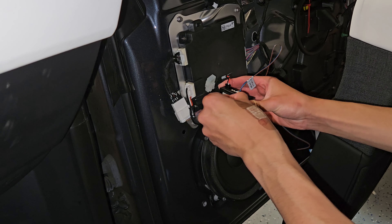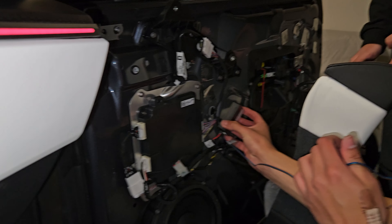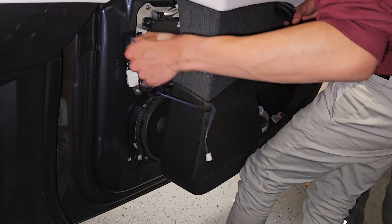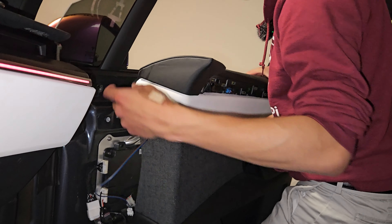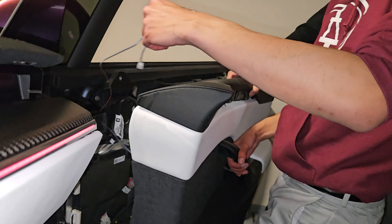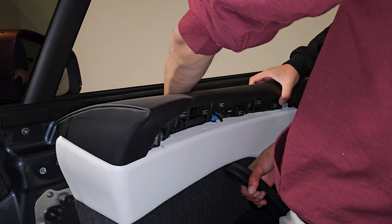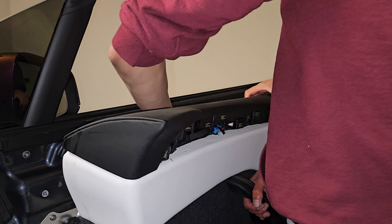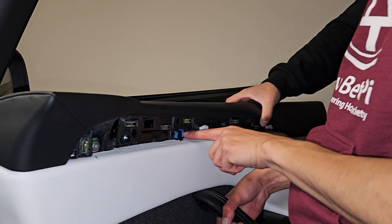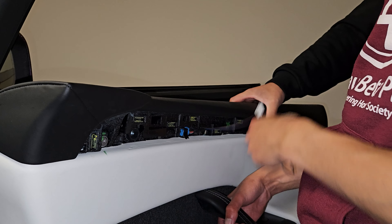Undo the cabling so you have a little more room to run the wire. Fish the wire under here — it should sit in like this, and the wire goes to the lighting on the outside part of the interior door panel. Untie it and it separates from the box. Take off the 3M backing and slap the receiver right here — that's a pretty good spot. You'll see a green light pulsing; look down and you should be able to see it. Then take this wire and fish it through a hole in the door — any hole works, but on a newer Model X there should be a blue clip coming out of a hole you can use.